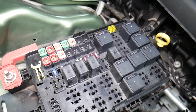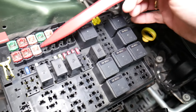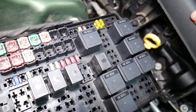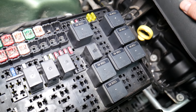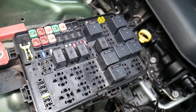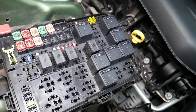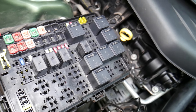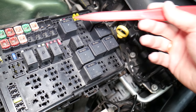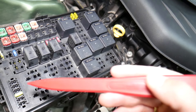Before we continue, let's explain why it's important to test fuses and relays. It is super important to always test them. A common mistake people make is assuming a fuse is good visually — sometimes you cannot actually see if the fuse is clearly burned. You may put the fuse back and end up spending money and time on parts you don't need. All you have to do is test the fuse. We'll put a link in the description on how to test fuses — it takes only a few seconds. The same thing applies to relays, which can be really expensive on some cars.